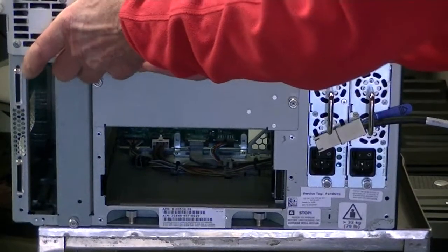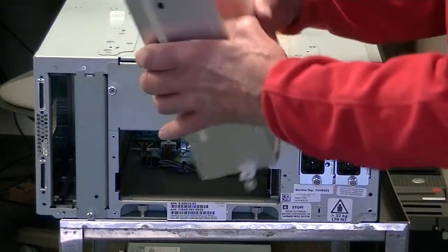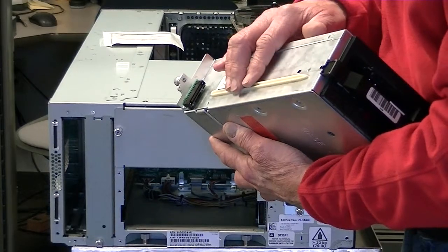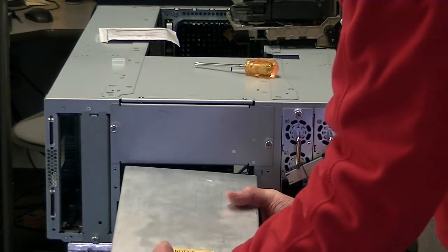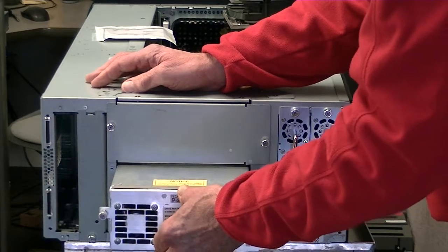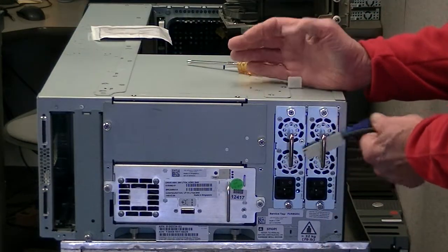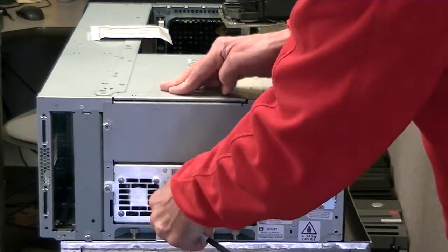You can place the drive here, and if you want to reinsert another drive, grab it and put it here. On this particular drive, you are seating a connector into this connector here. These are the rails that it rides on, so you can't get it in the wrong way. We're going to insert the drive — it sits here. Get it lined up in the center and it'll slide in there very easily on the rails. You get to that last quarter inch, and this is where you give it a little push and it's locked in place. Tighten these up, put the SAS connector back in the same way it came out, and you're good to go.